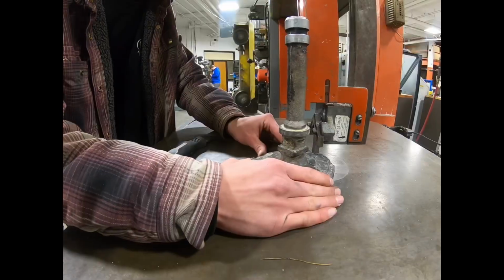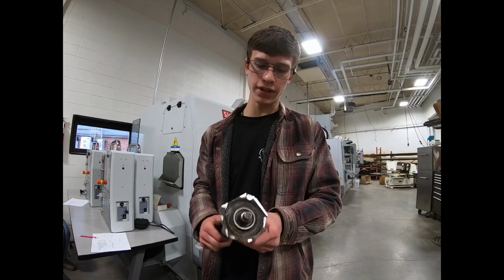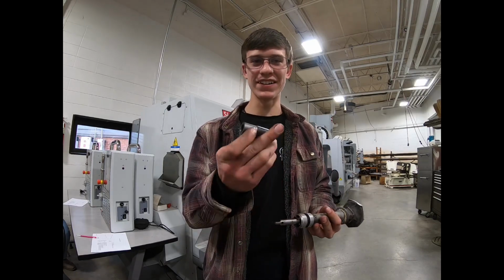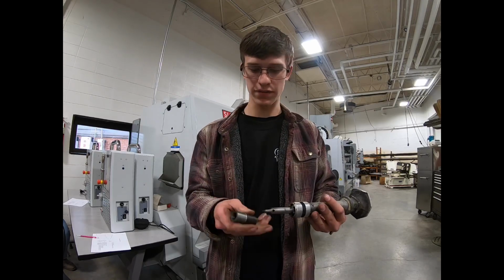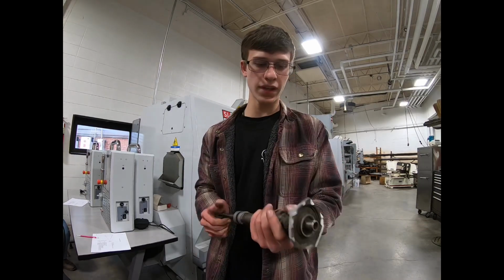All right, boys. So we're about to bandsaw a piece of metal. All right, I've got this electronic type distributor that I cut down, butchered on the bandsaw, and I've already taken the gear that goes on the camshaft that drives the oil pump, and I turned it down so it doesn't engage the camshaft anymore. So I'm just going to reinstall this and then put an electric drill on this end and drive the oil pump.